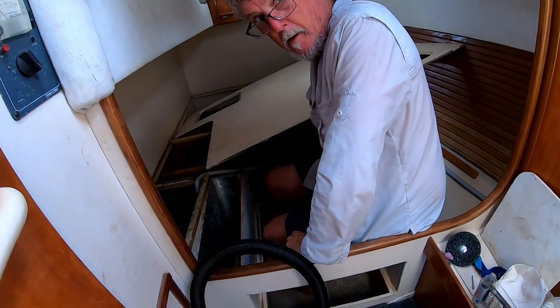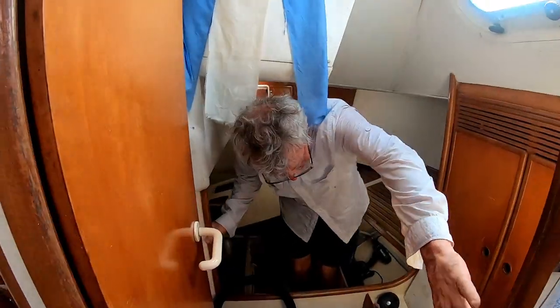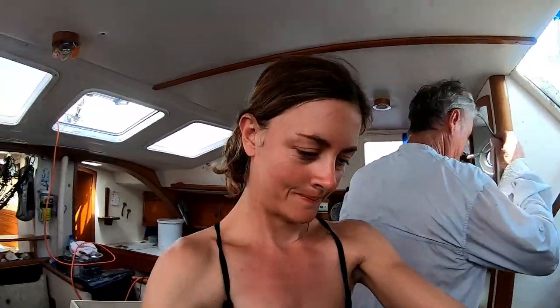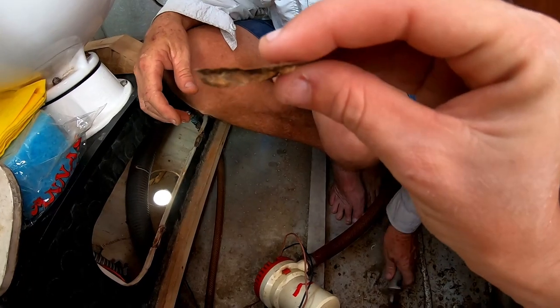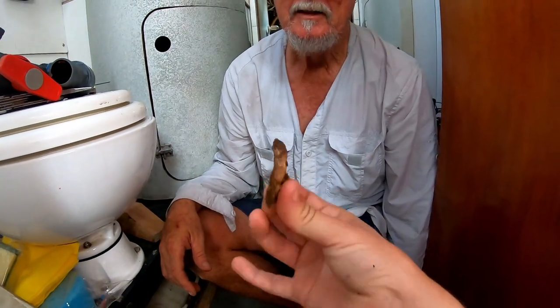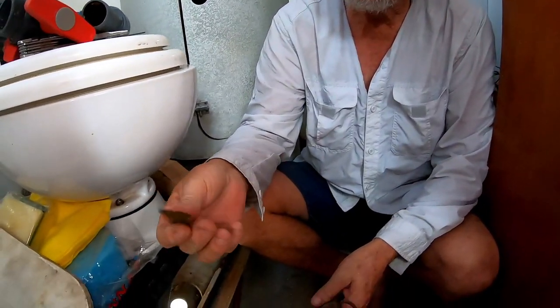The whole boat's apart — needs to be. I thought we could do this bit. Nothing bad there. I've basically done that front section for the most part. It's one day and we're definitely going to have to do something there — weld? This is what happens when you epoxy over a little corrosion in the aluminium without doing anything else — you end up with an entire giant hole in your aluminium. Dad went through that with the knife with no pressure at all, which is a little scary to think that was all that was stopping a leak in the boat.